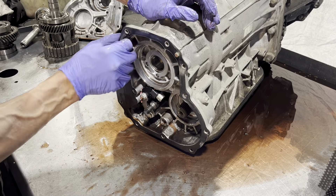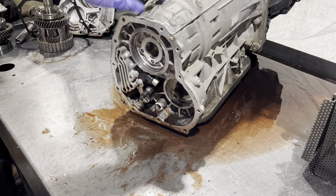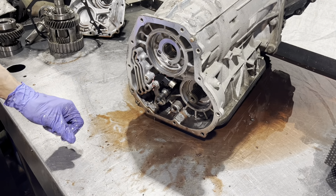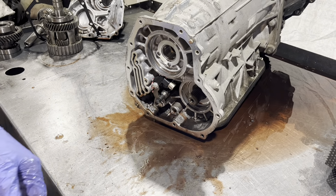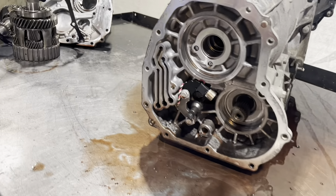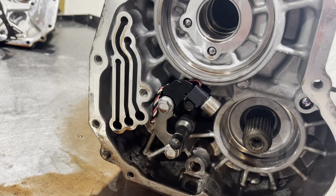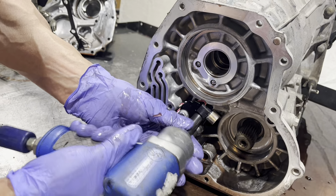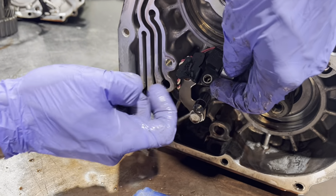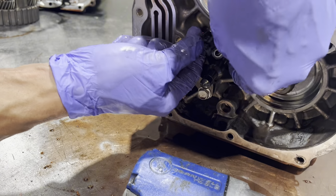And the parking rod. We also have an upper shaft speed sensor back here. These don't really go bad — the only time I see them go bad is if your center differential wipes out and a gear tooth gets caught in there and actually tags the sensor. Take a look in here because there's a specific way to get it back in. This goes under here — there's a little tab that holds it and it goes back in.